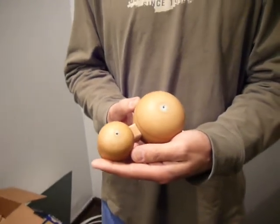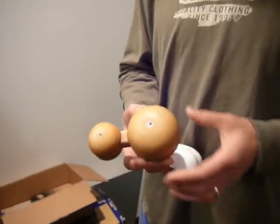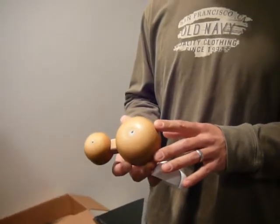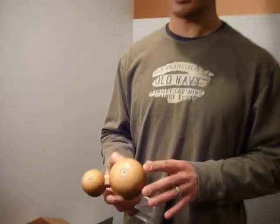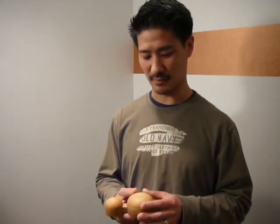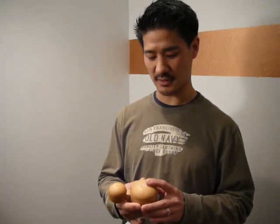These pucks were housed in a lathe and then ground to the contour that I was looking for using a die grinder and the lathe, and that gives us the side profile contour roughly, and then from there just smooth down with 80 grit sandpaper, and then maybe finished up with 150 grit sandpaper.